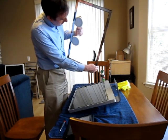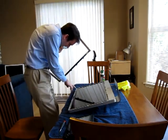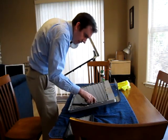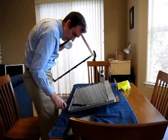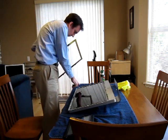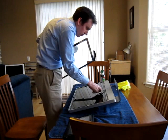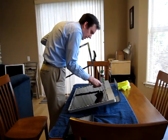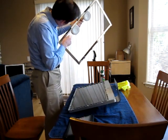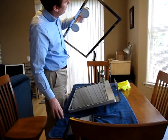Impressive. So there are a couple of tabs that hold it in the bottom bezel — some alignment tabs here. I'm guessing there are some magnets around the edge here. Yep, in fact there are 14 magnets along the top. This bottom bar might be slightly magnetic, but that may just be because the screwdriver is somewhat magnetized. It looks like it's just this thin sheet of steel around the edge of the monitor, right behind the black area of the front bezel.